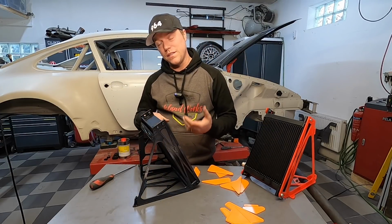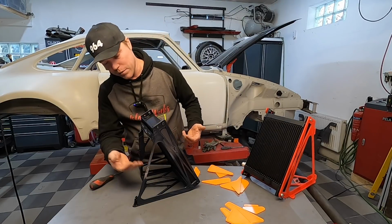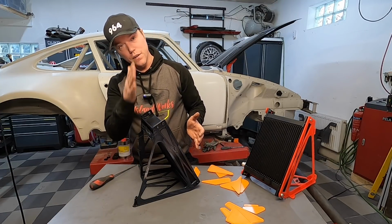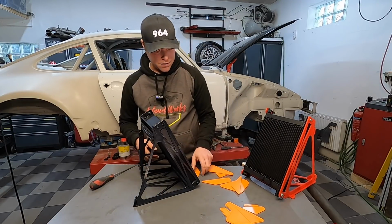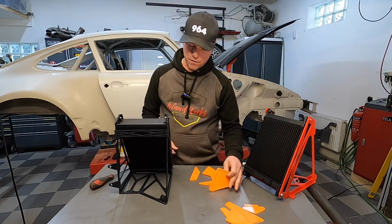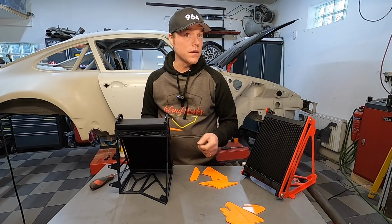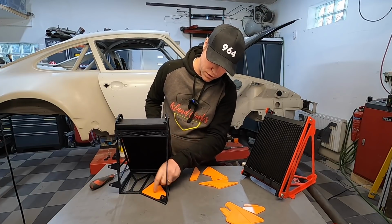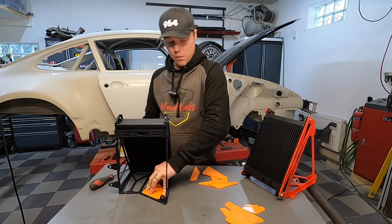For this to work as a real proper cooler console, it can't look like this with all these holes through here, because the air will try to come in here and won't be trapped. On this side, you have the car body, so there's not an issue here. Here's the wheelhouse out here in the back. So this technique, that I don't know if I invented it or someone else did, is based on making a skeleton here and then plugging the holes. So these ones will be printed or manufactured out of carbon fiber, and the only purpose that these have is to plug the hole.